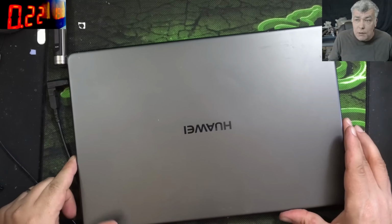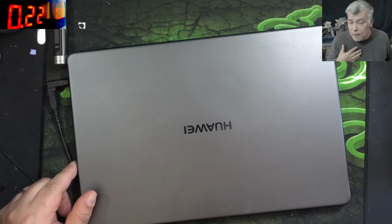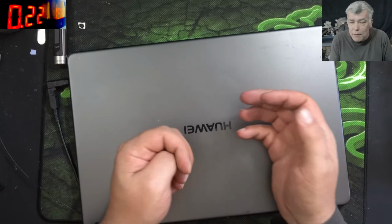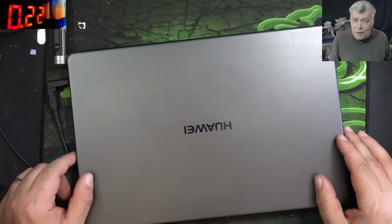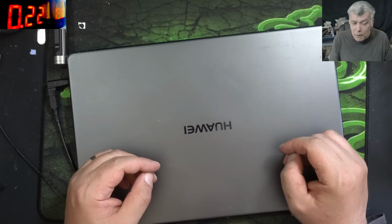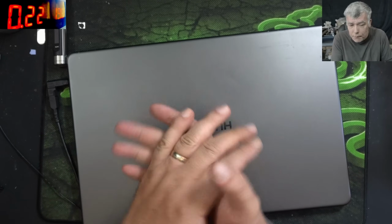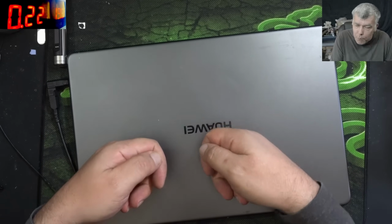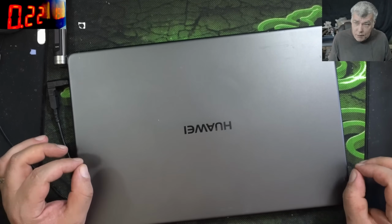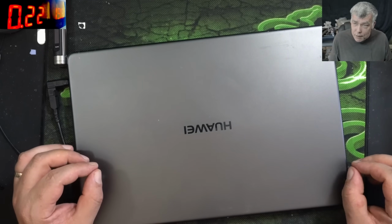And I know the issues new people in repair have, because I've been there, and it feels bad to charge money for things like using compressor and cleaning the fan, but it's not like that. It's like a proper job. You can have a surprise. The heatsink is stuck because the thermal paste is old. You put some pressure, you crack the CPU, and you have to buy another motherboard. So it is a risk. Most of the money we charge is for the risk itself.